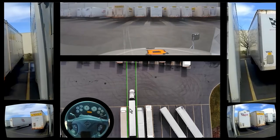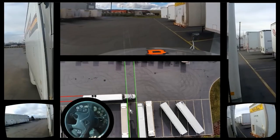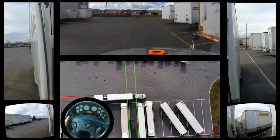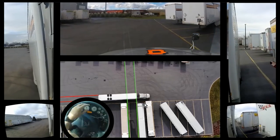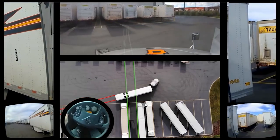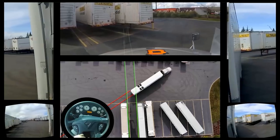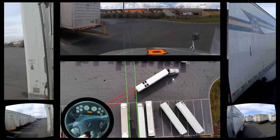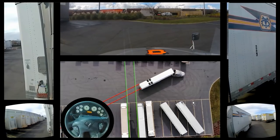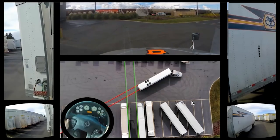That's how you would get into the space. Now let's do it in a blind side — a lot more difficult. Okay, so here's our space. We look at our space. We're gonna turn the exact same time, right at the end of this space. Hard left. Now I turned actually a little bit too long in this one. Back off to the right, and usually I will make sure I stop at an angle where my tractor is running parallel to this line here of the trailers.